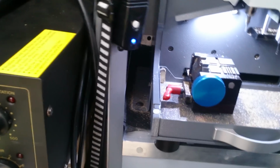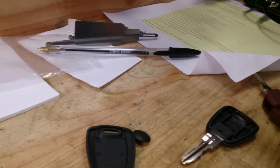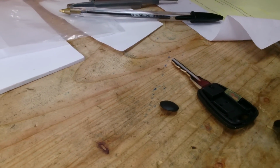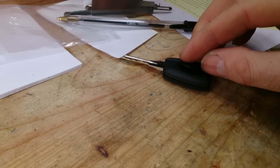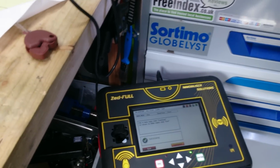Okay, as you can see, this key is now cut. There's a key, all cut. What I'll do first of all, I'll just pop that transponder in the key. It's quite hard working with one hand. Pop that into there. I don't post out genuine Vespa keys because they're rather expensive, and a key is a key. So we've got the key. We just may have to take the number 9 cut out to a 3. It may not fit, but there again, let's see how good I am.